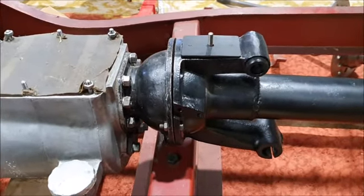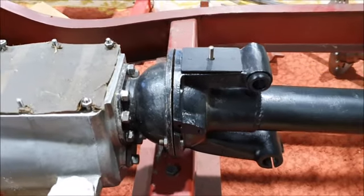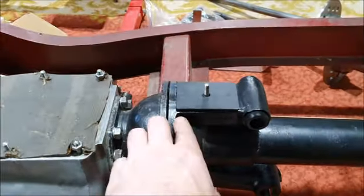And that's where the plastic helps, because the plastic is self-lubricating. It doesn't need extra lubrication, so that should be fine. But there should still be enough oil going down inside there to get into the sliding joints and the torque tube joint, hopefully. So I need to make a new leather gasket for this.